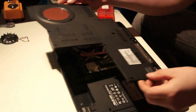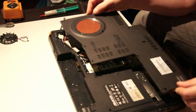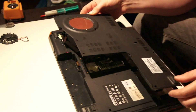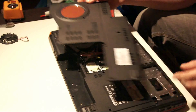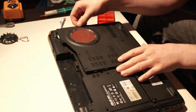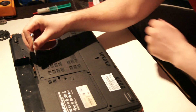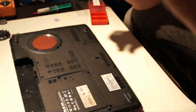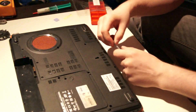Now we take the back cover — all the screws are still in the holes, I have not taken them out at all. Just put it back, but be sure to put this side back first because you have some hinges here that should be inserted here. And this is the last screw. Now it's fixed — we have replaced a fan on the ASUS G50V.